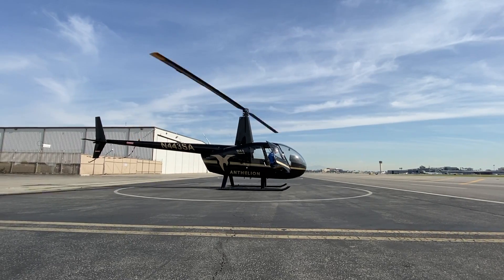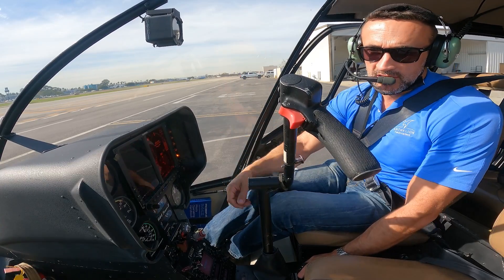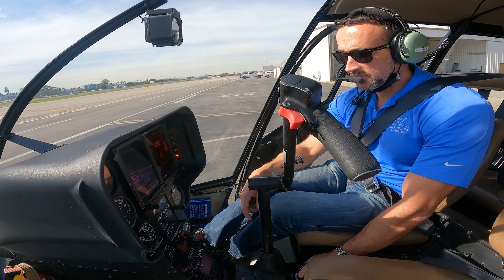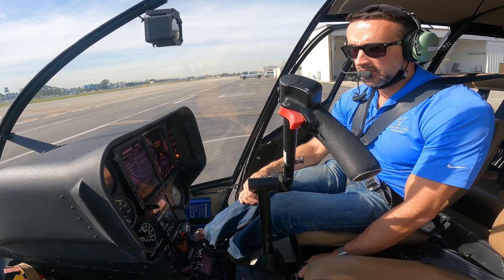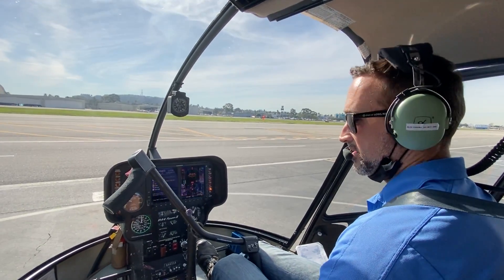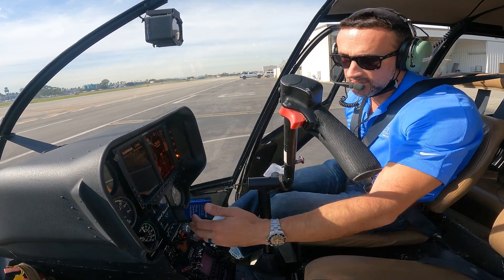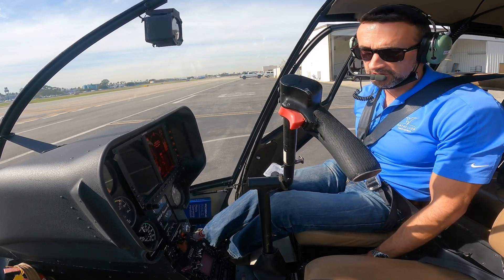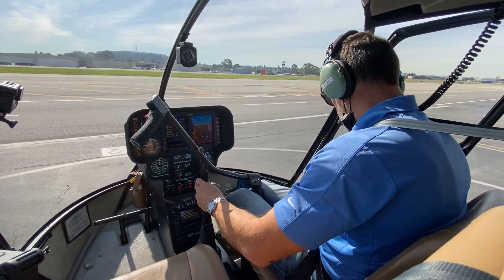Engage the clutch, engage the alternator — that's on the bus. Now to recap what happened quickly: as soon as the engine caught, push the mixture in, make sure the guard is installed, and stabilize RPM at 50 to 60. Check that the starter light goes out — if it keeps going, there's a short circuit, shut the aircraft down immediately. Also verify positive oil pressure; we need 25 PSI minimum. With a cold aircraft, oil is very viscous so we're running about 110 PSI right now — it will reduce as the oil warms up.